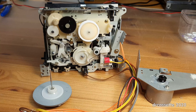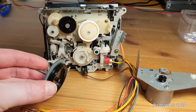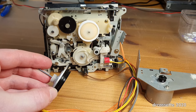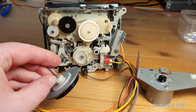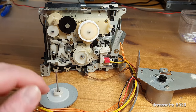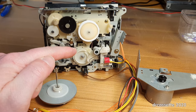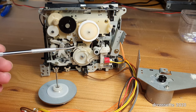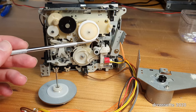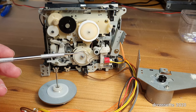I've taken out the flywheel. It does not only have those two pulleys there and then this pulley down here — there is also the gear right there, and this is important. This gear engages with this special gear right there, and that is part of the soft touch mechanism. In fact, this follower and then this arm is what moves the head bridge up and down.